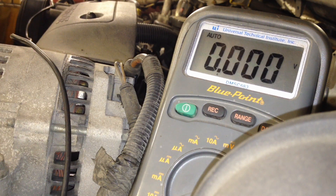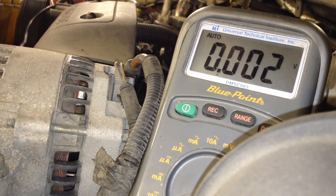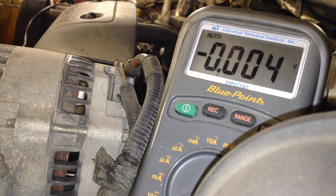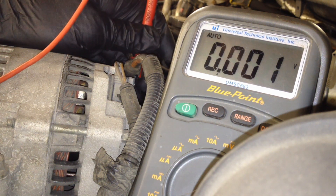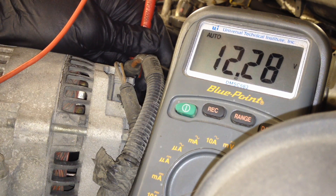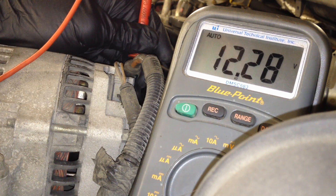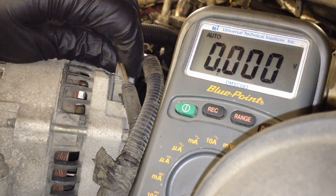What you're going to do is take your multimeter and put your negative lead on the actual negative of the battery. Turn the key on, engine off, then go over to the big wire, which is the actual power output feed, and test that one first — make sure you have an actual path back to the battery. That's the most important. Put it on the stud back there. I've got 12.28 volts static voltage, key on, engine off — we're good there. We've got a reference for what the actual battery is running at.